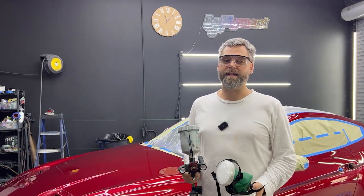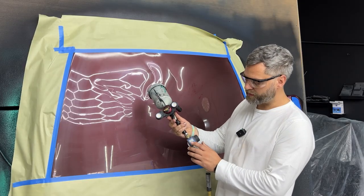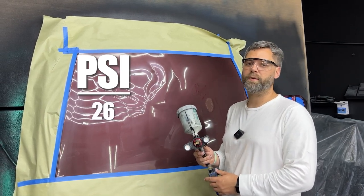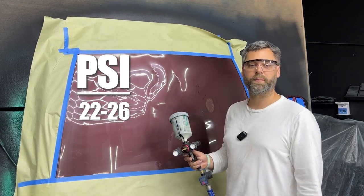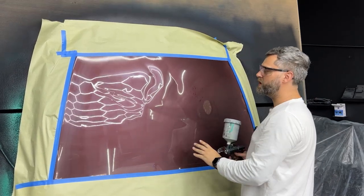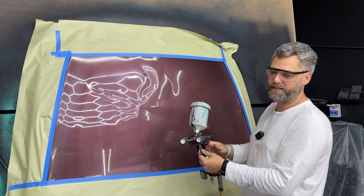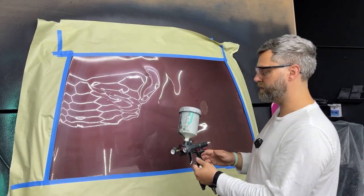All right, let's move to the test panel. I'll show you guys a little bit of a slower pace as to what I mean. Let's go. When it comes to PSI rating to your gun, you wanna be around 25, 26. I wouldn't go any higher than that, and I wouldn't go any lower than like 22. So between 22 to 26, somewhere in that range for your base coat. Our first few coats are gonna be very light, so we obviously need to prepare our gun for this. So let's say you just open up the box of the gun, you're getting it all set up, run mineral spirits through it. They do put wax and grease. Number one, run mineral spirits through your gun.